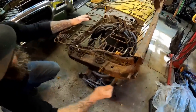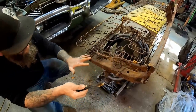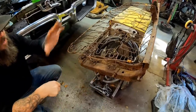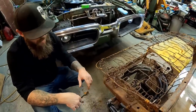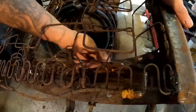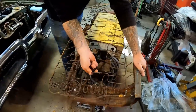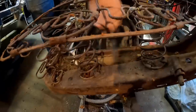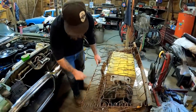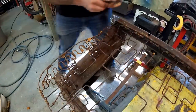The way rust killers and rust inhibitors work: they want you to get the crust off first — anything that's flaking or coming loose. They don't want you to sand it all off with a grinder; just get the loose stuff off. Then when you come back and spray or brush that stuff over the top, it will convert the remaining surface rust. You do want to get all the flaky stuff off first. The frame is actually solid — it's mostly old foam material and decades of spilled drinks that are crusty down in there.